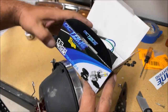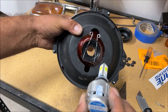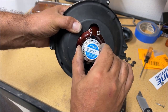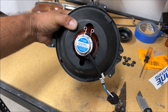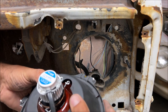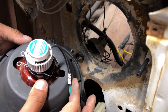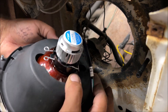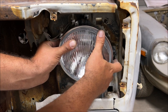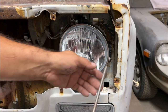Put the Octane LED light in there like that and close it — that's up. Just clock it where it looks right — beautiful. We have the two headlight adjustment screws installed and the spring pushed in. You're going to find a little notch on the bottom of your bucket and hook the spring — it's actually very easy. You're going to try to get it on the screw; it can be a little tricky. Kind of square the headlight up a little bit first.